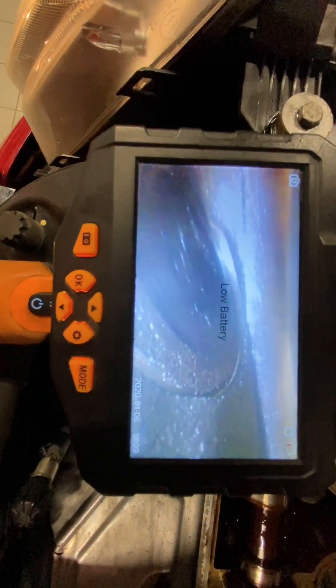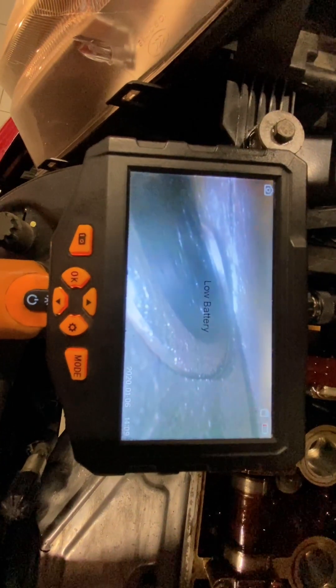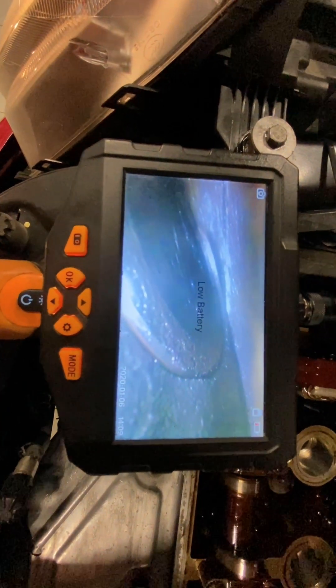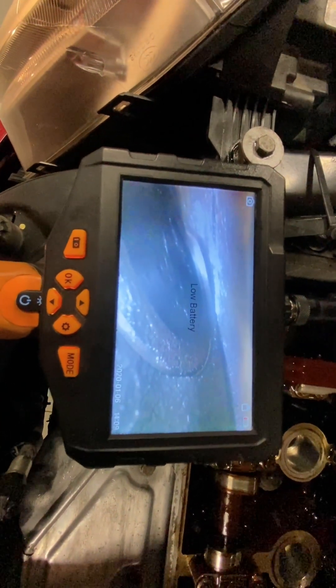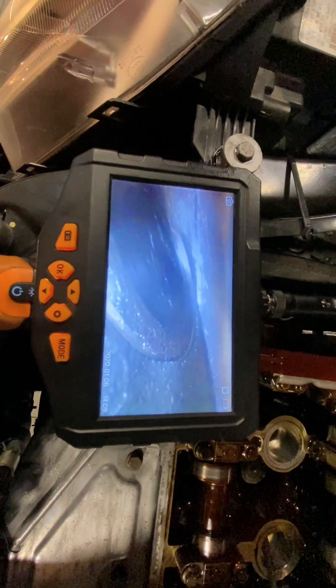What we've got here are the intake valves on number four cylinder. My colleague is turning the engine over as I'm looking with the borescope cam. There's the piston at TDC — as you can see the intake valve isn't opening. So that's why we've got fuel: it's not that we've got no compression, we just don't have any air. Simple as that.